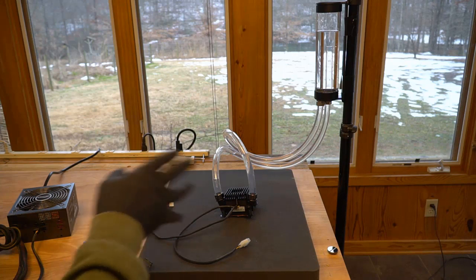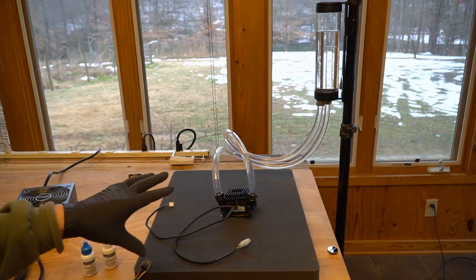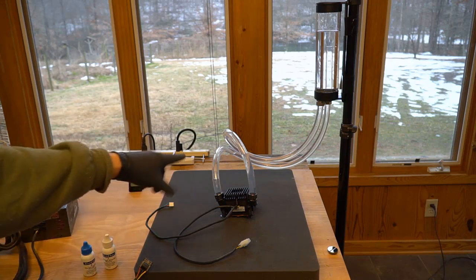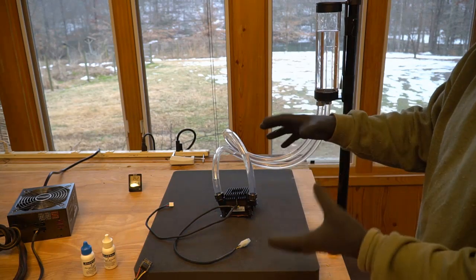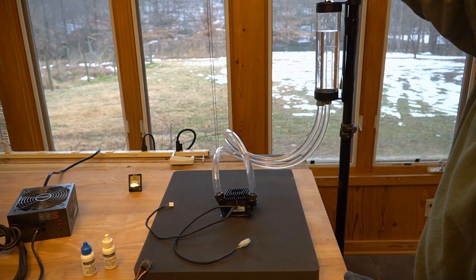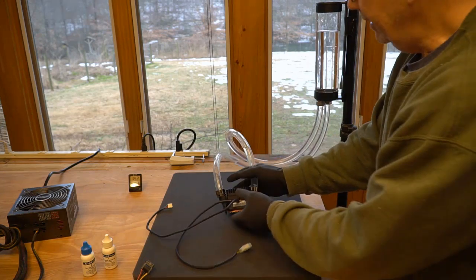Now, before you start your pump up, you want to use this cable that I gave you. So let's say you've got your new CPU. Your pump is mounted on your CPU, and you've got water in your radiator. You've got air in your lines. See, you have an advantage over me right now, because with your setup, you can tilt and tip the computer, provided you make sure that before you tilt and tip your computer, and I'm giving you this from empirical experience, make sure you put the cover on the top of the radiator for obvious reasons. But let's say you can tilt and tip your computer and get the air out of these lines.